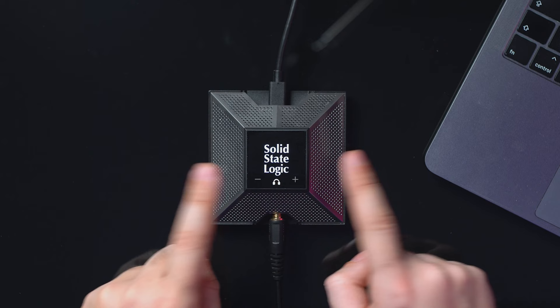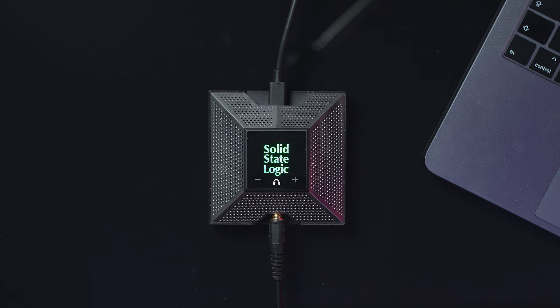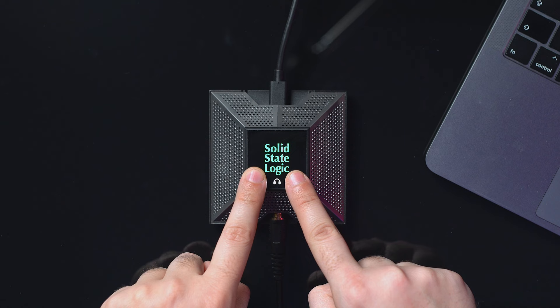To enter the setup mode, press plus and minus together — as you can see it's now blinking. I can change the mode with a tap since it's all touchscreen. This is the Group mode, which is similar to Solo mode — we still have mono output — but all capsules are working at the same time and at the same level. This mode is for a group, so the interface should be placed in the center. You can hear it changes the sound somewhat, and all four capsules have the same level.